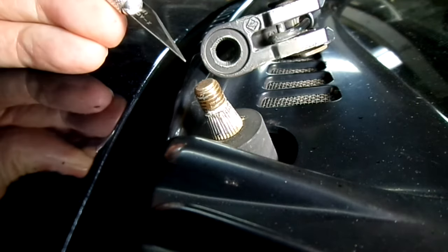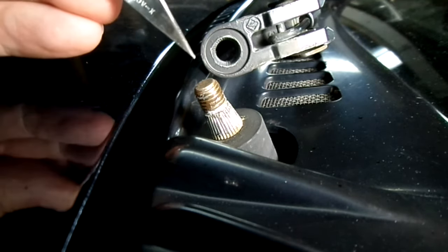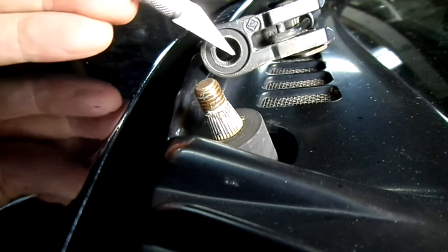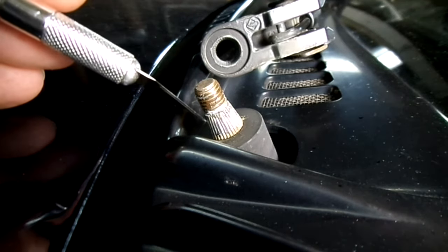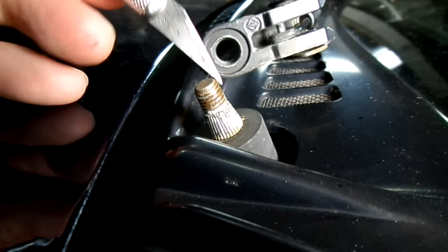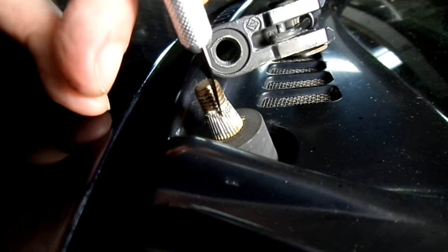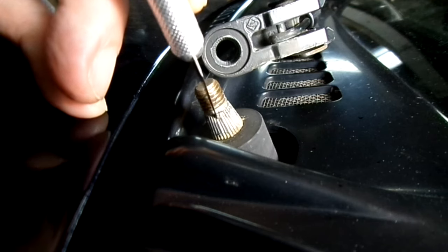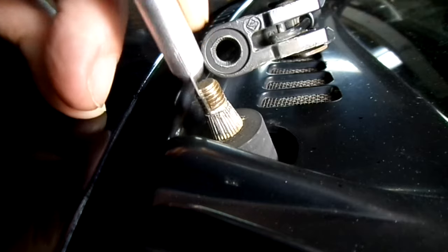What happens when that arm moves freely and doesn't turn anymore is these splines will rip the aluminum up in the arm, and then the splines get clogged up with that aluminum. So the repair we want to do: take an exacto knife like this, go into the splines, and clean them up — take off any aluminum that is in there and remove it.